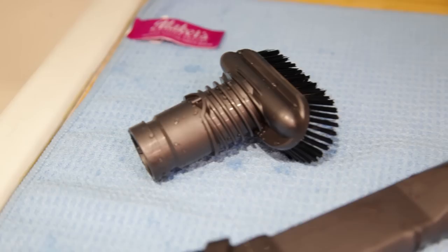In terms of frequency, you want to make sure you're cleaning your filter every one to three months. If you barely vacuum, you can probably stretch it a little further — but don't come running to me if you start sneezing uncontrollably. For cleaning the rest of your vacuum, you can probably do this once every six months or so. You can always consult your vacuum's manual for more information, but once every six months is quite reasonable.